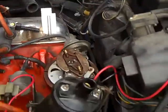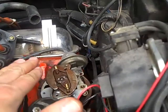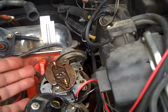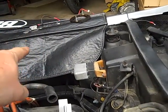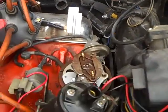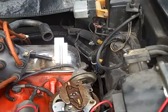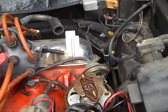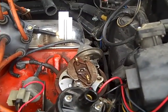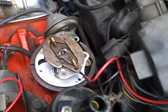With the original 1181, I had to pull the distributor out because I had too much up-and-down play on the shaft, which can cause it to rise and fall. You need the proper air gap between the magnetic ring and the pickup. That could change as you rev the engine up and down. So you have to pull the distributor out, push the roll pin off, take the gear off, put some shims on there, put it back on, put in the roll pin, then re-clock it — it's a hassle. Whereas the LS, it looks like a bolt-in-and-go.